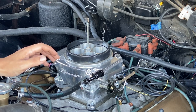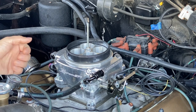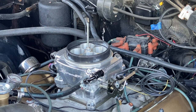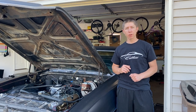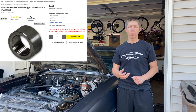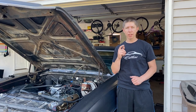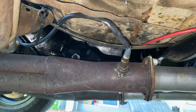With the Sniper system on, the next step is to go inside and actually program everything. The programming is really simple — there are videos out there on how to do it, and I'm not going to go into depth here. This is just a review and a basic install overview. Also, before we go inside, one more thing I forgot to mention: you need to install an O2 sensor. You need to either weld in a bung or use the one they supply. I didn't really like the one they supplied, so I went ahead and welded one in. You can see the bung and the wire going up to the front.